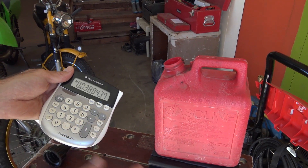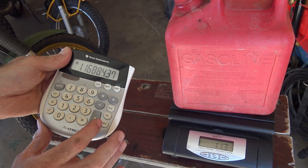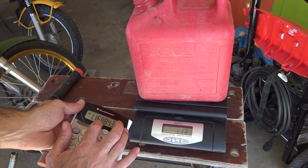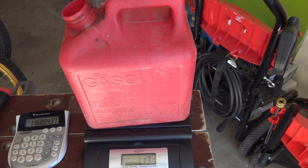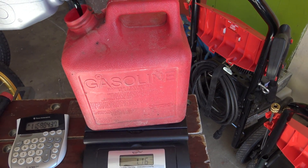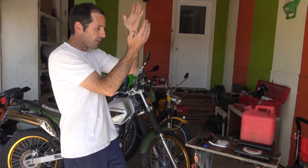We'll add that back to 1.13, so we need to add oil until the scale reads 1.17. To be safe, I'm not completely sure the weight difference between gas and oil is exactly 10% — the amounts I compared earlier were pretty small, so check for yourself or mix it on the smoky side. There's our number, which means we have approximately a 32 to 1 gas and oil mixture.